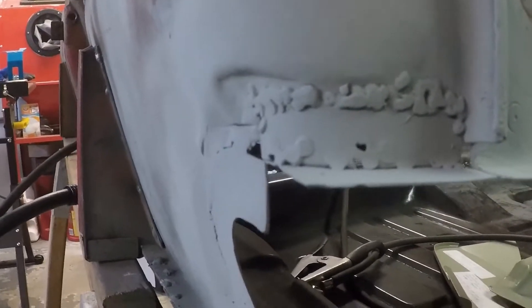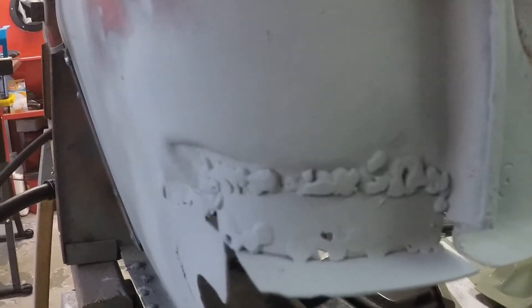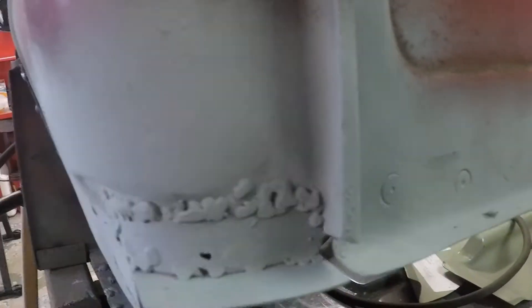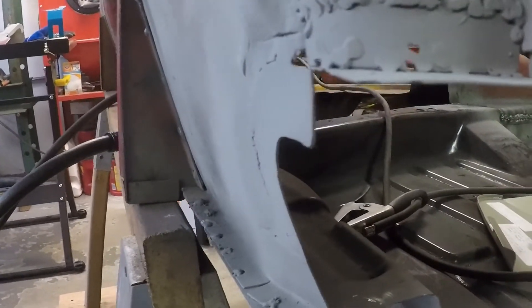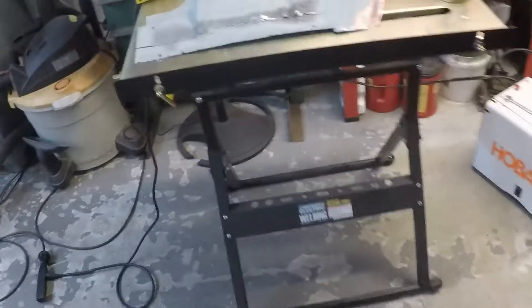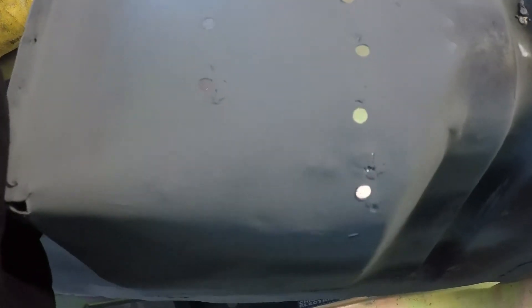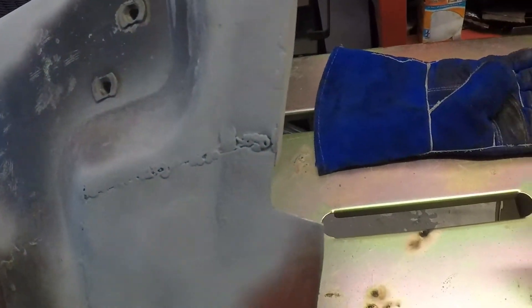This one here is a little even bad for my taste, but that's that lip I was telling you about. I essentially made almost like a ball cap brim — this lip here, this cross piece, and then I just cut that straight across and kind of faired that in. It lines up but it's pretty ugly. No other repairs under here, just kept that prepped. For the bottom A post I've hit it with weldable primer already, drilled the holes, got the internal supports for the B-pillar on there, and welded that piece in for a new lip. That's probably the best weld I've done.